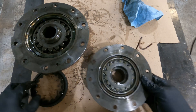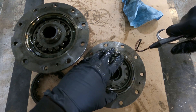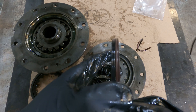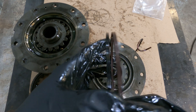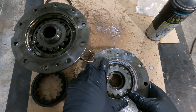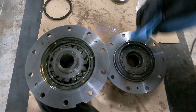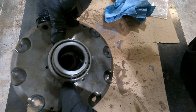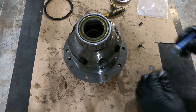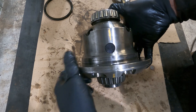So in this locker, the bonded seal is what needs to be replaced because it leaks air into the differential itself. Here's the new bonded seal — got it from Summit Racing. You can see the old one is definitely more worn than the new one. All I'm doing here is coating it in white lithium grease to keep the O-ring from tearing and make sure this repair lasts a long time. I made some witness marks to make sure I got the case back exactly the way it's supposed to go.